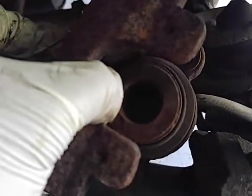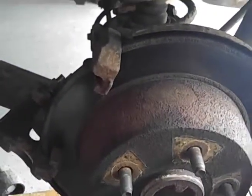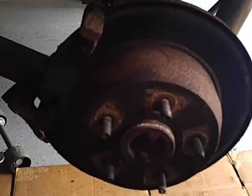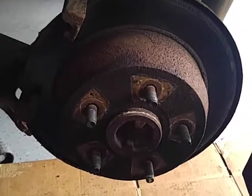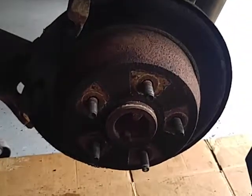The brake pad is going to have a little clip that goes into your piston, so just use a C-clamp to push that piston back in. Install your new pads, reinstall your caliper, tighten your T-45s, put back in your two plugs, and reinstall your wheel — which uses 19mm lug nuts. And that's it, 2003 Jeep Grand Cherokee rear brake removal.